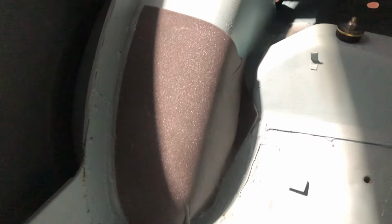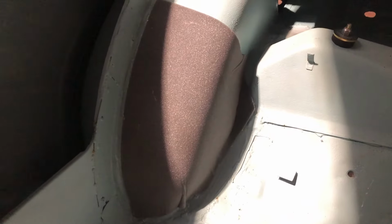What I found in the past is if you go right up to the edge with the foam, you have a problem getting your rear quarter card on. You have to push off the foam, so try and stay away from the edges. Probably give 5-10 mil down the edge, just so your rear quarter card fits alright. And you always get creases in this, but I try and make sure the creases are out of the way so you won't see them. It's just a funny old shape. Maybe you don't always get creases in. I always do, but I'm not a trimmer, so you live and learn.